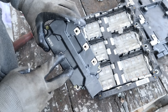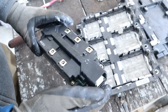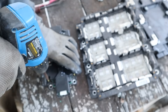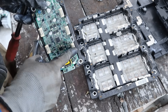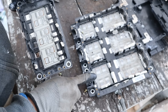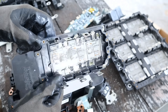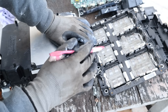Here's the driver for the rear electric motor — very similar concept: DC in, three-phase AC out. You can see it's less than half the size of the module for the front electric motors, because it's meant to be a part-time slip-and-grip system. You don't use this motor for a very long time, and the motor itself isn't cooled very well. Inside here you can see the IGBTs — insulated gate bipolar transistors — six of them. The transistors are much smaller compared to those in the front motor. The voltage path goes from DC to the three-phase AC for each phase, and it's also covered in that gel. Having it separate makes it more modular when producing front-wheel drive and all-wheel drive versions of the RX and Highlander.